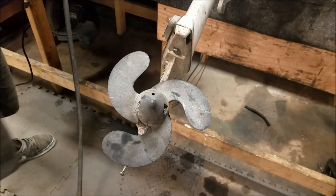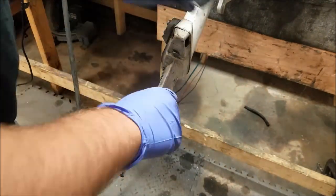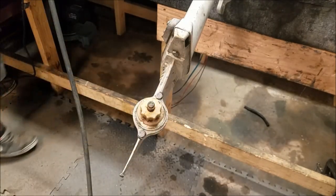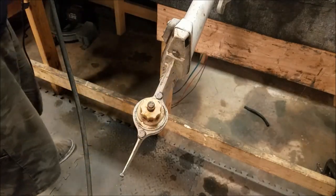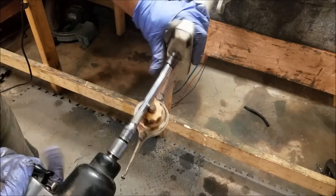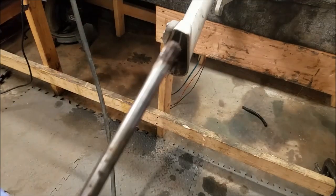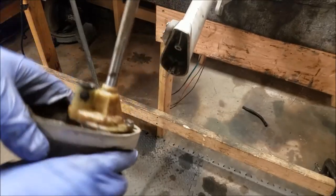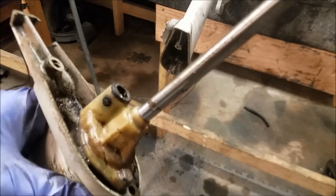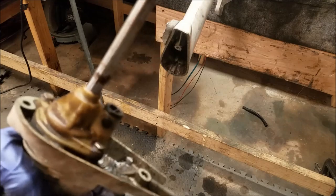Here's the problem: if you're awakening a dead or unknown outboard such as I'm about to do with this thing, you really should change the water pump. So I'm going to pull the lower unit off and check the impeller before I spend any money fixing this thing. I use this impact wrench for everything. I'm going to need to re-grease the splines — that's just nasty, any longer and it probably would have seized in there. The rubber's pliable and not too bad. Let's get the pump off and have a look.